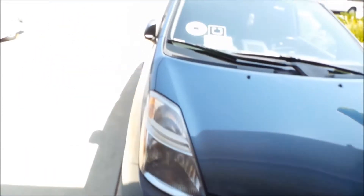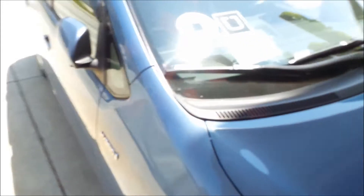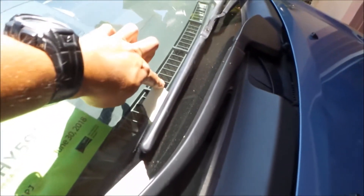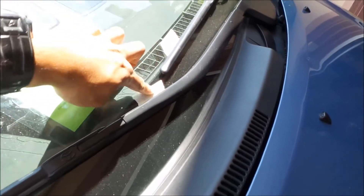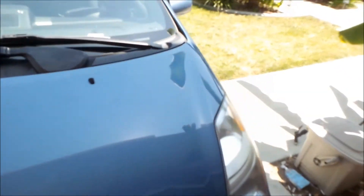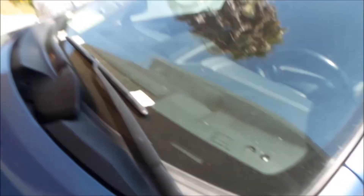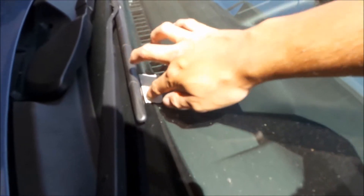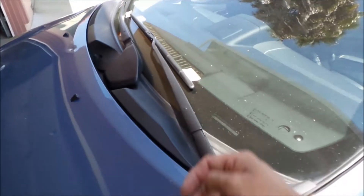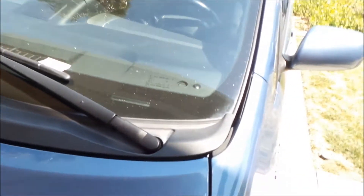Neighbors will complain. So here I've put tape where the wipers are. I used some masking tape to mark where the wipers are in like two places, so I have a general idea where they should be when I put them back on. Because we've got to take the wipers off to take this cowl off.